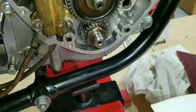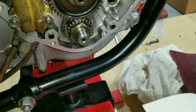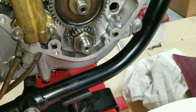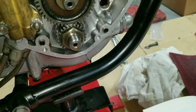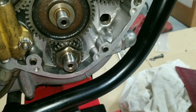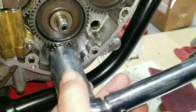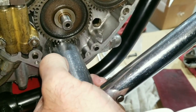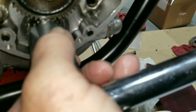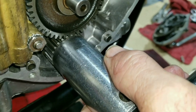When we go to turn it a couple of times and it doesn't line up again, we won't be alarmed — that's expected. We want it tight. We're deciding between 70 and 80 foot-pounds. We don't think 70 is overdoing it, so let's go 70. Right now we have it with the socket wrench, but we'll torque it down in increments to 70 foot-pounds. That's 70 — alright.